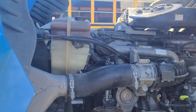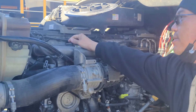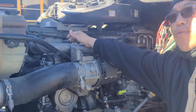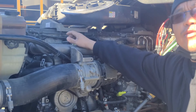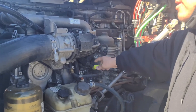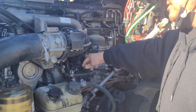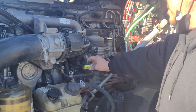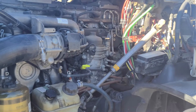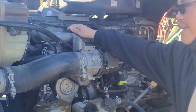From right here, I'll move on to my engine oil cap. My engine oil cap is not cracked, not broken, not damaged, in the locked position, not leaking. The rubber seal is still on the side, has no abrasion, bumps, or cuts, and is not leaking. My engine oil dipstick is where I'll service it. I'll pull it out, wipe it clean, put it back in, pull it back out, and check the level. If I need to add oil, I'll add it right here by the cap.